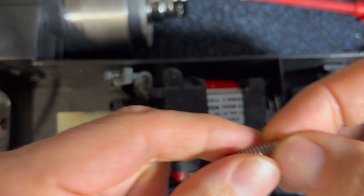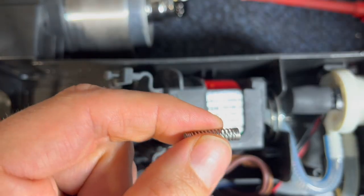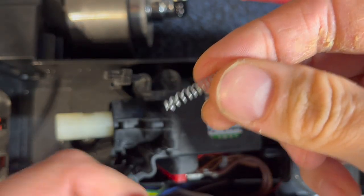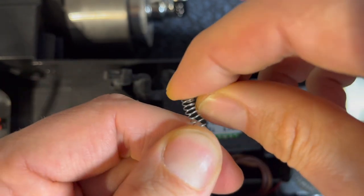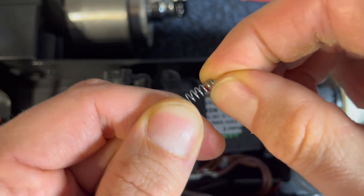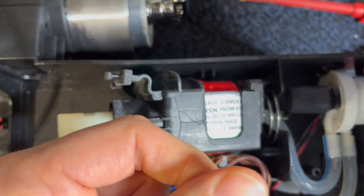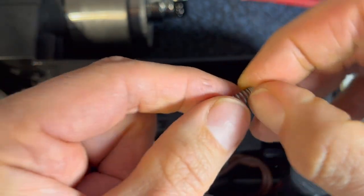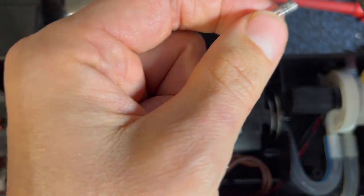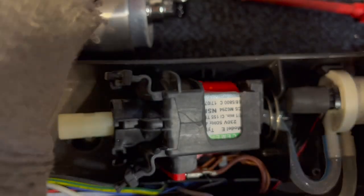What I'd like to try now is to take the original spring and shorten it a little bit. With the pen spring at full length we got way too high pressure — possibly because it was so flimsy it may have buckled inside the OVP and never compressed enough to open the hole. The original spring is more stable and stiff, so I'm going to remove just a couple of turns of the wire and see if we can get closer to nine bars.